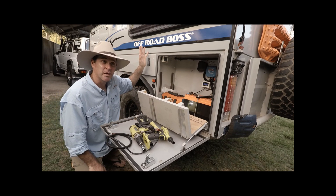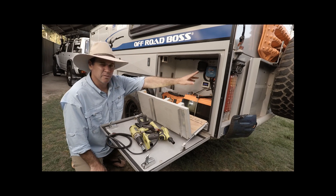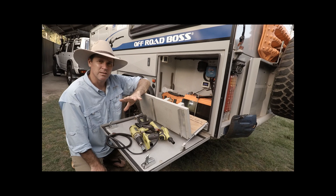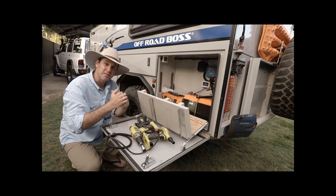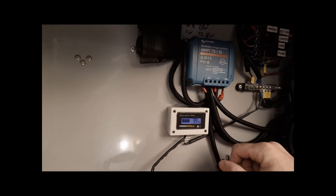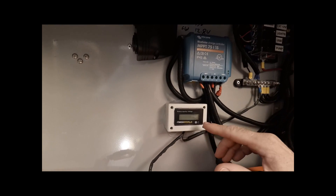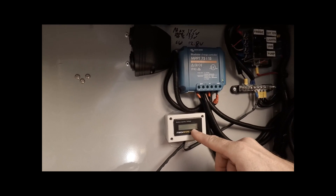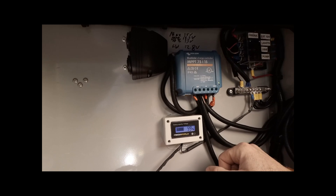It's been so efficient, and that's a cheap, super-cheap panel — not an expensive one. It's got the Victron 75/15 MPPT solar regulator. So with all that full use, 99 percent — no charge from the alternator. How good is that? Just to give you a look at the battery monitor — it's got an off switch, which is cool. A lot of volt meters don't have an off switch, so it's fine if you run it through your car accessories, but on a trailer, what do you do? So: 13.3 volts, 99 percent. Unbelievable.